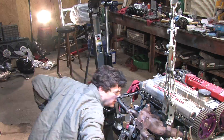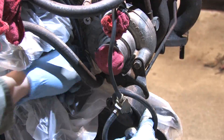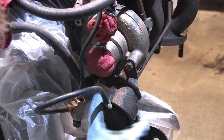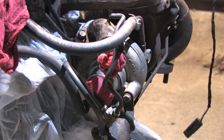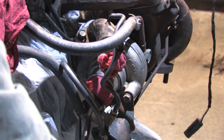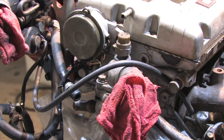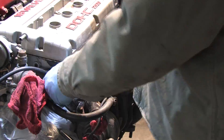Unfortunately I've got to separate some manifolds and buy some more gaskets — so much for the budget. Honestly I've got more invested in tires than this repair will cost. I put the head back on the block because with the cams installed some of the valves are open and can easily be damaged. I need to take the turbo and intake manifolds off so that I can easily do the rest of these modifications and clean up everything else that touches oil.